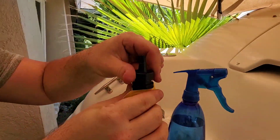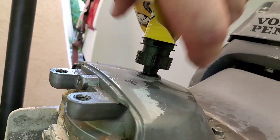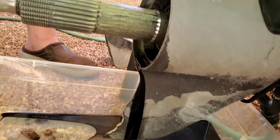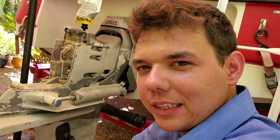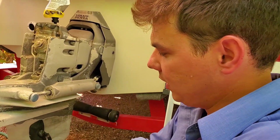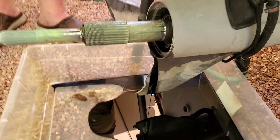He just trimmed the little tip. What we're going to do is squeeze in a little bit — it looks like we're just going to fill it from the dipstick hole. We'll squeeze in until it starts to run clear. Alex got a lot of extra gear lube, so he'll squeeze in about half a pack and we'll see if it starts to run a little more clear because that was pretty rough looking. The gear lube is good to do every season — at the end of the year before you're done, change your gear lube so it sits over winter with fresh lube. That way it doesn't pit the metal gears and seawater or lake water doesn't corrode anything.